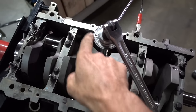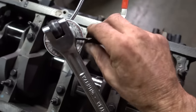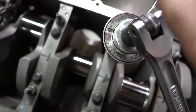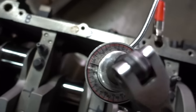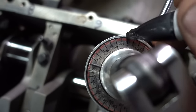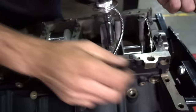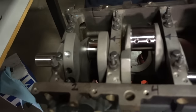I'm going to give you guys the once-over on torque-to-turn versus foot-pounds on a torque wrench. This is a turn-to-tight wrench. You set your base up so it sits still, loosen up your little set screw, and put this little indicator to zero. We need to turn the inner bolt 80 degrees. The big thing is we're doing this with factory studs just to check our clearances, and then we're going to take these out and replace them with ARP hardware.